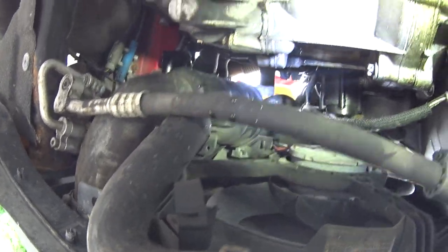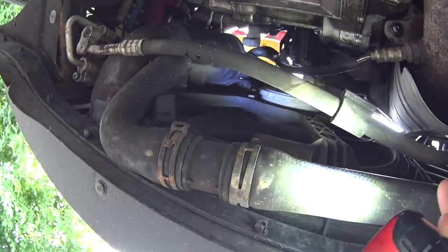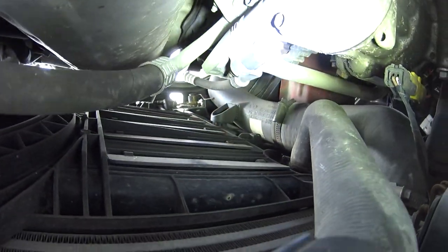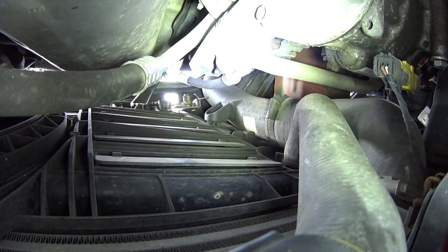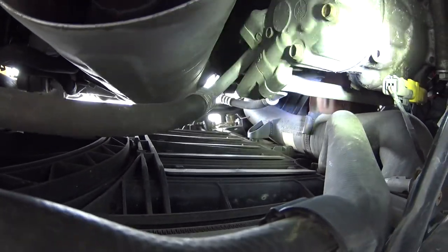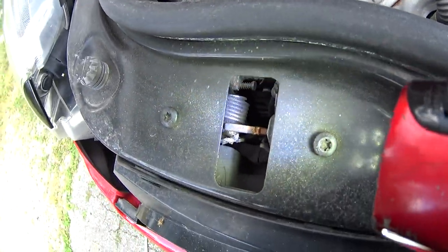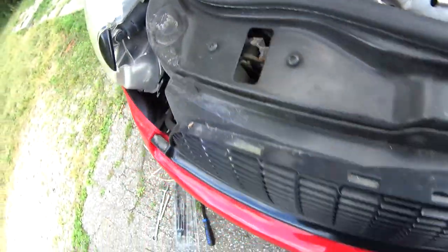On the driver's side you have to work your way around the intercooler piping and the coolant piping — it's up in there somewhere. Then do basically the same thing I showed on this latch: either strike it with the palm of your hand on the back of the pry bar, or use a hammer with one or two decent-force hits and it should just pop open. It's pretty dry — I didn't know this was a common problem on the MINIs until now. Got to get it cleaned up and greased, same thing on both sides.